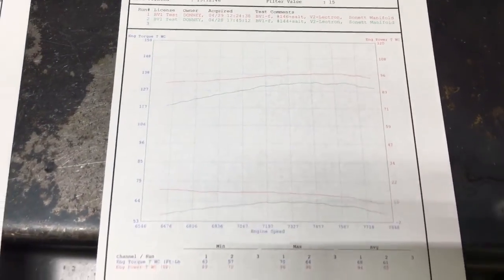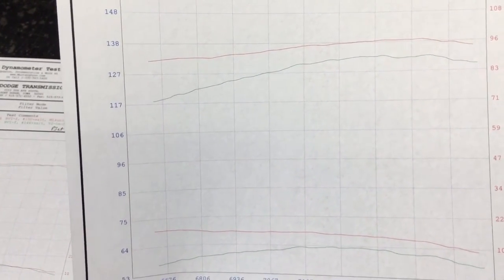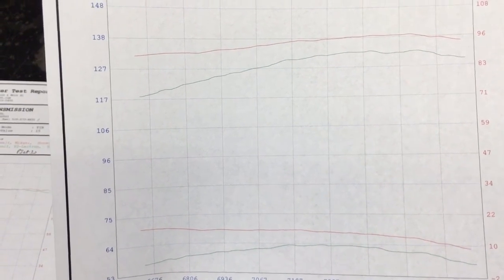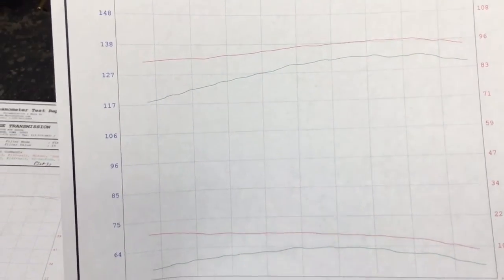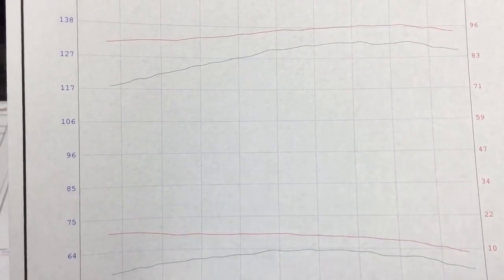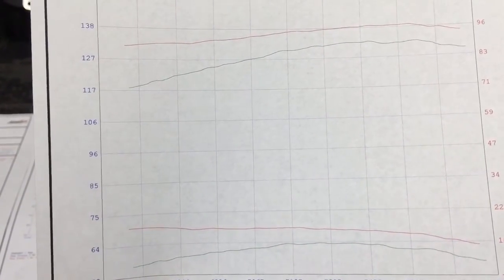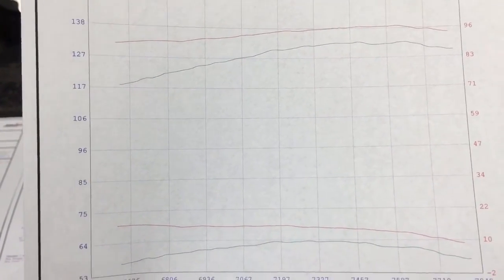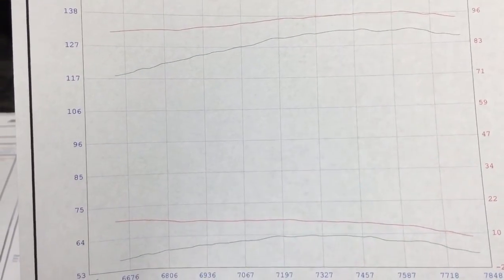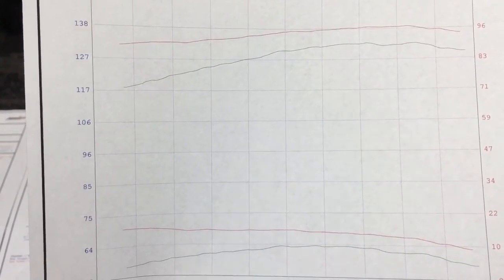One thing I did want to show you here, the only difference in these is jetting. The bottom number, the green number, was an engine that was fed a little bit too much fuel. You'll see all the time, especially in diesels, where they pour all that black smoke out the exhaust pipe. Every time you see black exhaust, think of horses, black horses. That's black horsepower going up and out that's not being utilized. That's an inefficient engine, and the same will hold true with these Saabs. If you're smoking a bunch, you're running too rich.